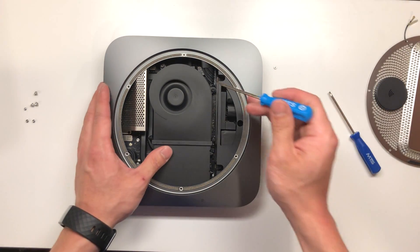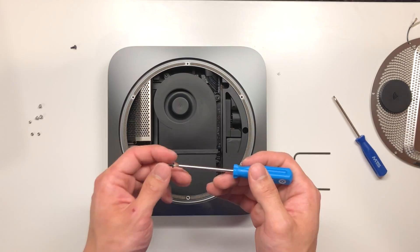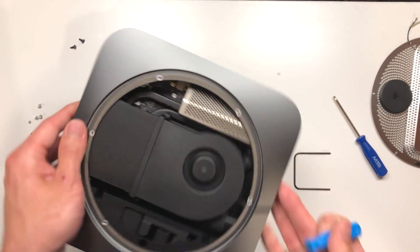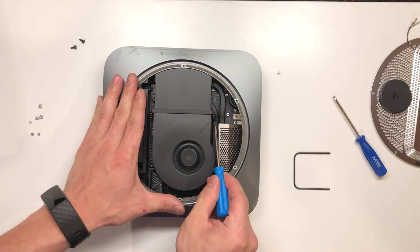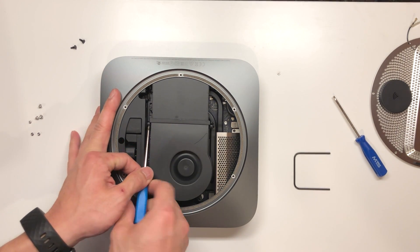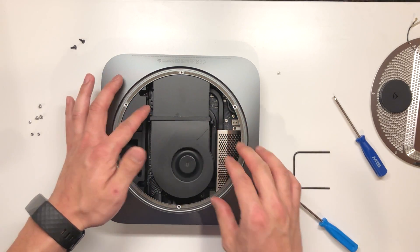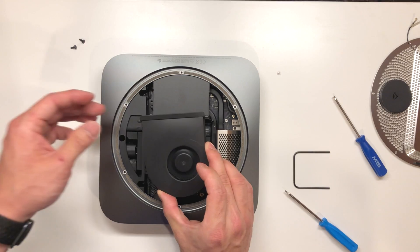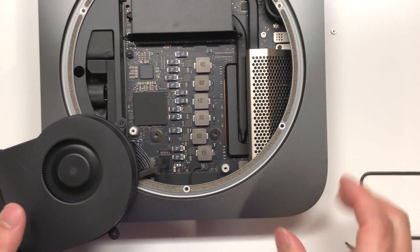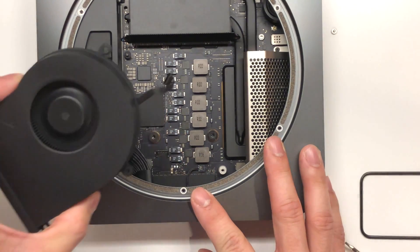Now I am going to take apart the fan. There is a screw right here at the top — again, same screwdriver. Second screw right here has been removed, and there are two coming in from the side right here. So I'm just going to turn this Mac mini around and go from the side. The two screws are loosened but they've fallen into the logic board — that's okay, we'll remove those after we take out the fan. We're going to gently peel up on the fan. There is a connector on the fan — it looks like you just pull straight up on it, and it pops right out. So we'll set the fan aside.